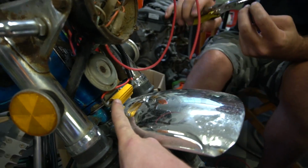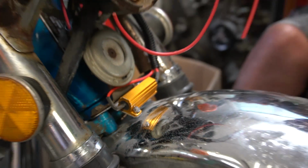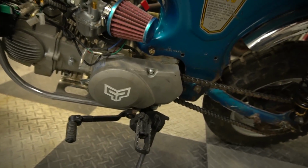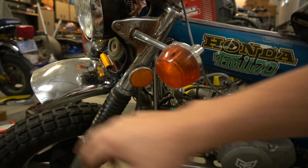Got the resistor down here with a nice little bracket he made out of the Jeep hood. There are only 3 wires coming out of the case here, and none of them appear to charge. So all that effort I put into making this nice capacitor work could be wasted, because I don't appear to have a charging system on this engine.